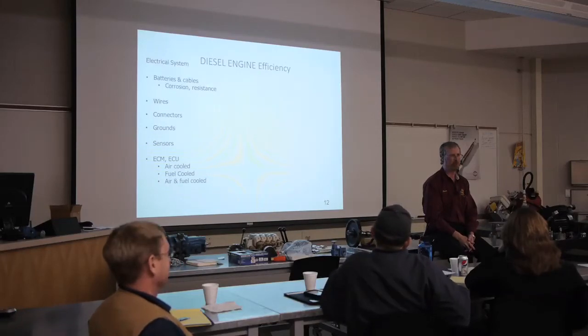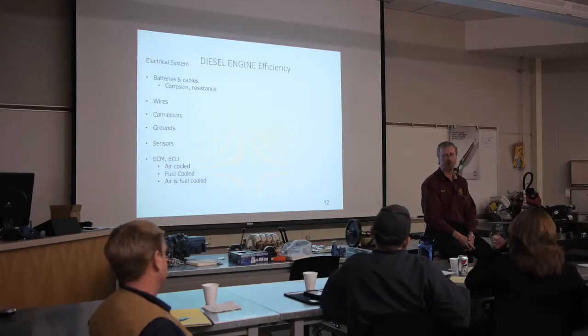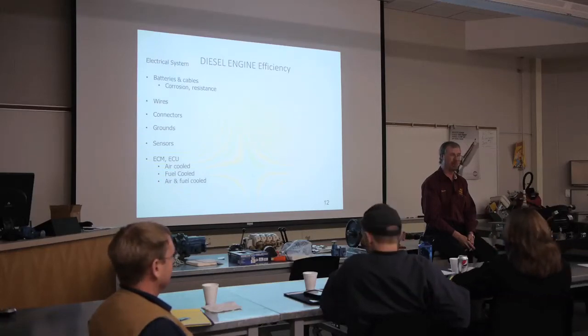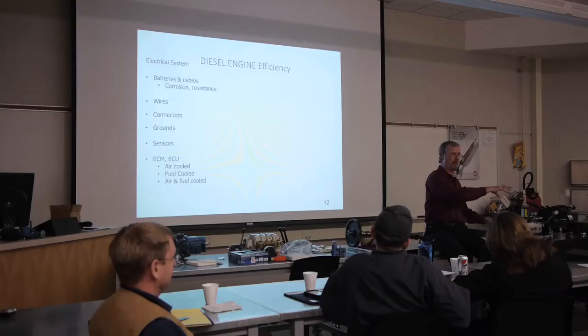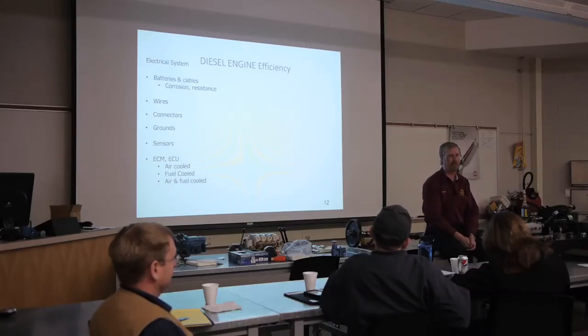I guarantee you, very few of your producers will know the answer to this one. You guys heard of hydrogen gas? When a battery charges or discharges, it produces hydrogen gas. You mix flames or a spark with hydrogen gas, things are going to blow up. And I have seen the results of a battery blowing up. I never, ever want to be around a battery when it blows up. Very, very bad deal. If I made that fourth connection to the battery, I'm completing that circuit. There will be a spark. Guarantee it. If there's hydrogen gas there, it sucks to be you. Really, really bad.